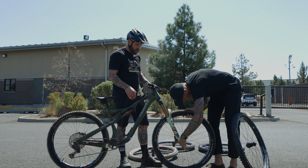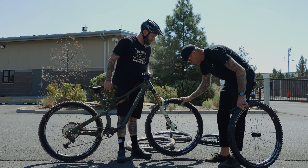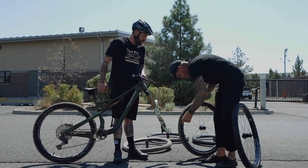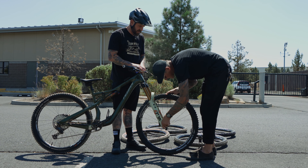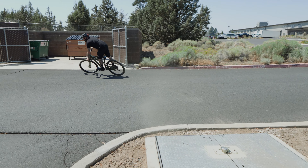Now switching to Super Gravity — this now has four layers of carcass on the sidewall and two under the tread, built very similarly to Super Trail but with added sidewall layers. The apex will be nearly double the size. You should feel this ramp up considerably.